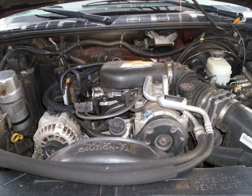The Chevrolet 90-degree V6 family of V6 engines began in 1978 with the Chevrolet 200 CU in as the base engine for the all-new 1978 Chevrolet Malibu. The original engine family was phased out in early 2014, with its final use as the 4.3L 262 CU in V6 engine used in Chevrolet and GMC trucks and vans. Its phase-out marks the end of an era of Chevrolet small-block engine designs dating back to the 1955 model year. A new generation 4.3L 262 CU in V6 variant entered production in late 2013, based on the LT1 small-block V8 used in the 2014 Chevrolet Silverado.